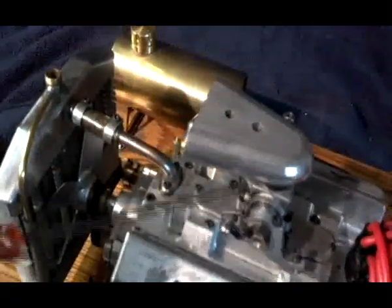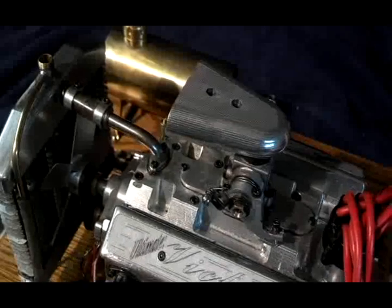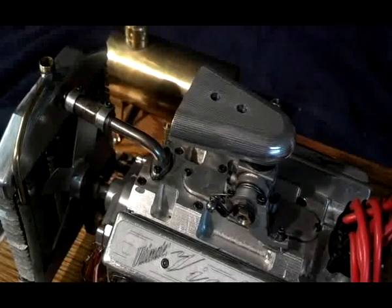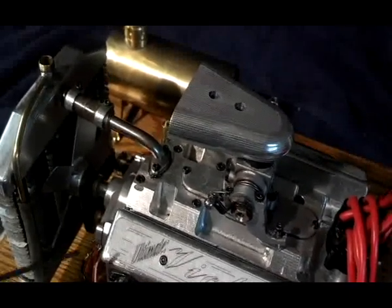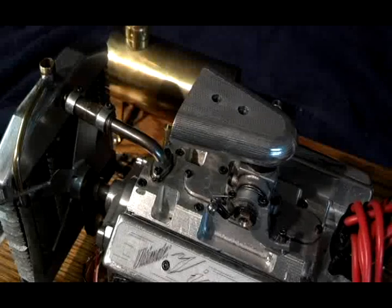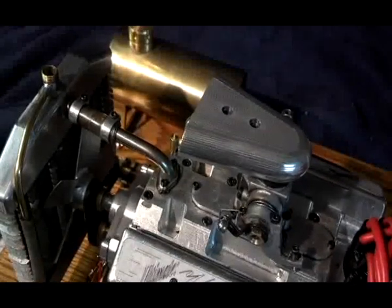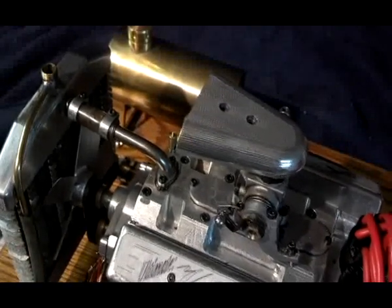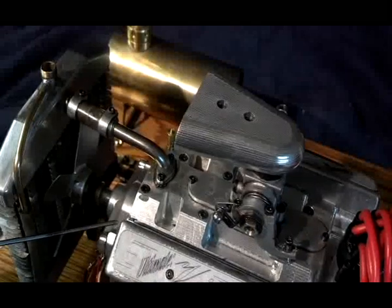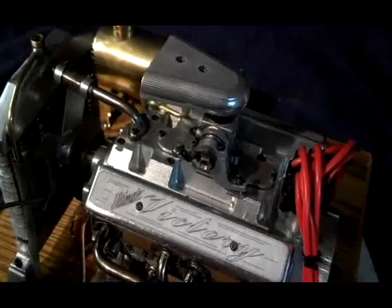The air cleaner is aluminum. It's an aluminum block and aluminum manifold — most everything's aluminum. All parts were made by me except for the spark plugs, which are NGK ME8 spark plugs, nuts and bolts, and the carburetor. It also has bronze shell bearings in the rods, which is quite different from the original Victory which just had aluminum bearings.